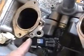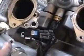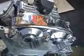Mark your connections on the inside before you disassemble them. Before pulling out the injectors, you have to take this connector here off — it's by that screw right there. That will allow you to turn the throttle body toward the alternator side in order to get out the rear injector. This is something simple but could create problems if you don't pay attention. Note that the fuel lines actually go toward the rear of the engine, so when you pull this out and turn it, you know which way it goes back in.